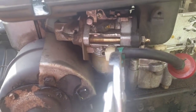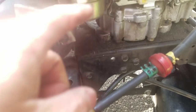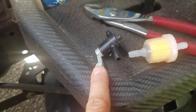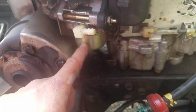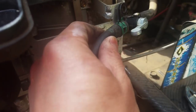The first thing we do is disconnect the fuel line. This hose is new so it was really rubbery and mounted on there well — didn't even really need the clamps. Since I'm doing this on my own personal mower, I'm going to go fancy: I'll put a see-through gas filter on there and add a fuel cutoff switch so this doesn't happen again. Just turn the switch off, run it until it burns up all the fuel, and you're good for storage.